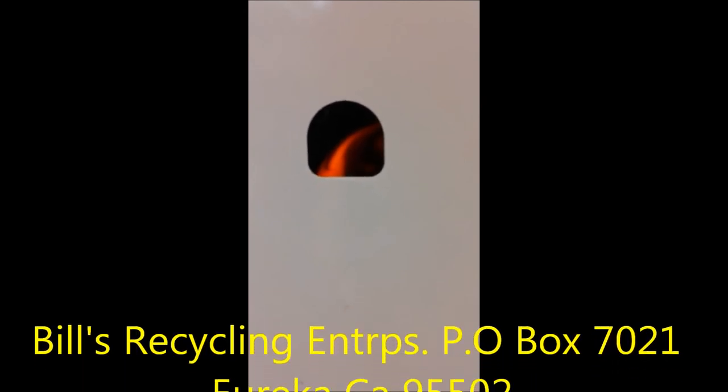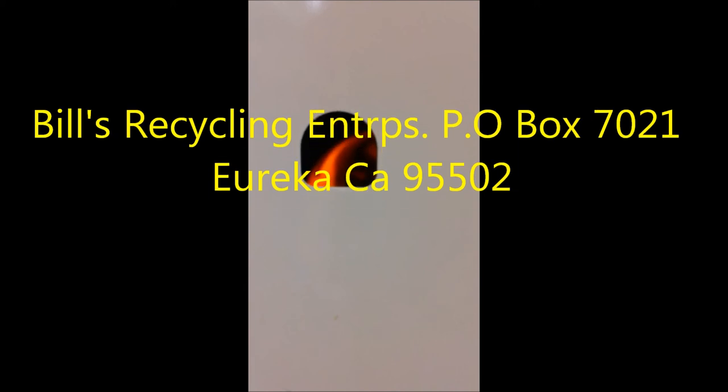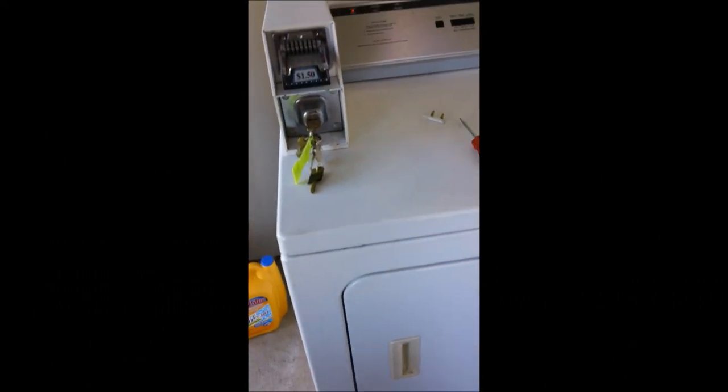This may take a little while because it's already heated up. We hear the click — the click indicates the igniter should be glowing or should start to glow. We see the igniter glowing and we should see the flame soon. And there's the flame. Try that three times just to be sure.